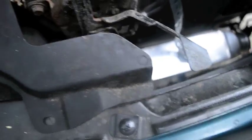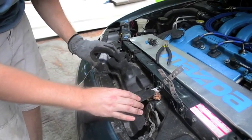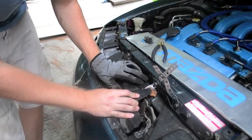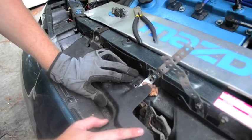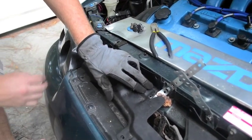See the intercooler down there? Underneath, to stop it from moving, I went ahead and drilled some holes, used some zip ties, attaching it there. I had to trim my little guard there to be able to fit through this. That pine cone is just to sort of push it stable, but that will be replaced with a more permanent solution later.